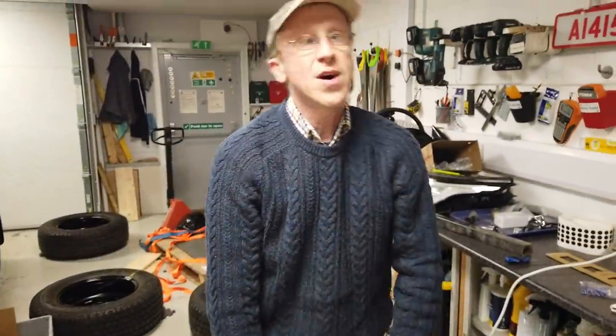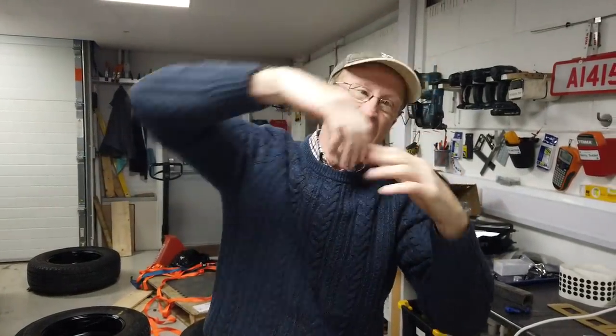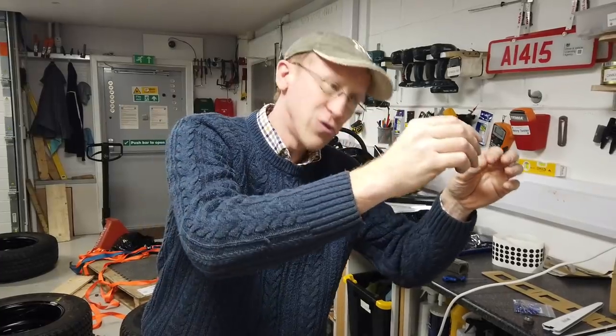Right, couple more things. If you watched our video where we were trying to go up those steps, we've had some discussions on Facebook about this, and the guy Adrian who runs that event said he's filmed several people trying to do it, and when we hit the steps, we really do boing up in the air, and we've got too much air pressure. If I had a football, and I dropped it, it would bounce if it had a high pressure. But if I make it half flat, it would just go bdoo. So I think we need to run with lower tyre pressures. And other people have commented that.